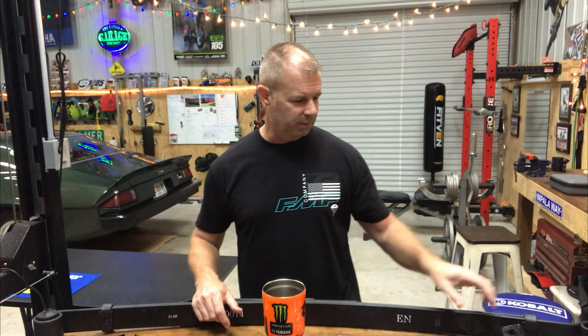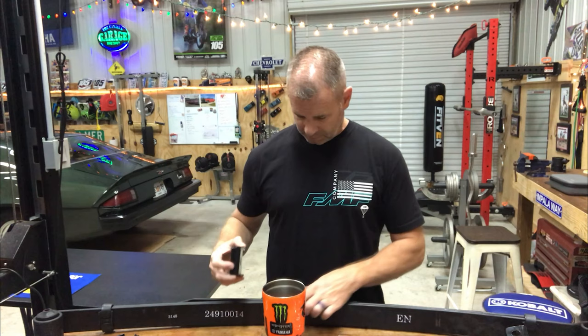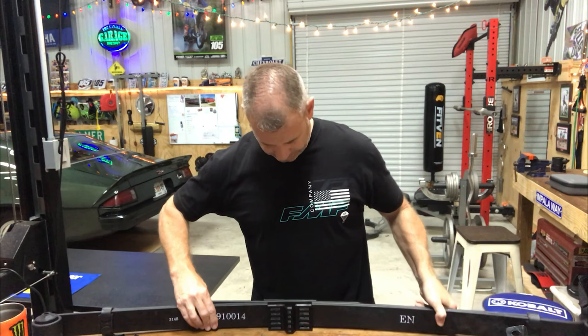Being that I had Caltrax bars in there, I didn't have the lower shock plate — the part the springs go through to support the car. I reached out to Summit Racing and they sent me these OER exact duplicates of the originals. The cool part is the locating pin fits perfectly, unlike the old ones. The upper also has a very large pin on it with no play, which is a much better setup. I'm looking forward to getting this in the car.